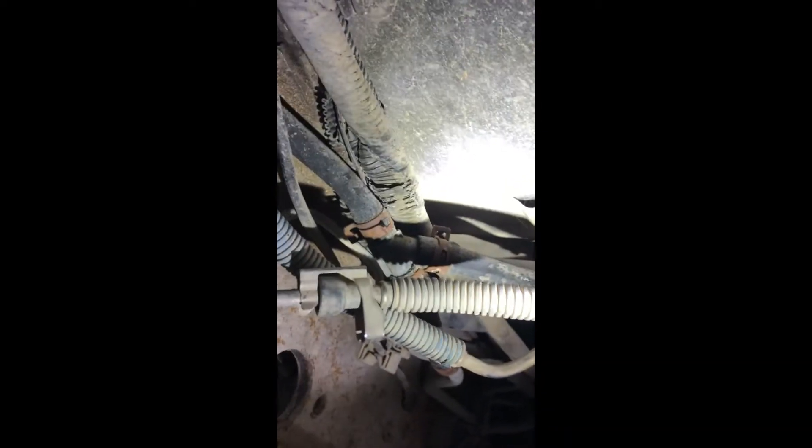I've been running this thing down for a while and got fed up with it, so I'm going to show you what I found and what I think has been the problem. That's the driver's front tire, and if you look underneath here, there's a fuel filter right there. Right there you'll see jumbled wires — I found these squished between the cab and the frame. Either at some point when Ford did some work on this and pulled the cab off, or at the factory when they built it, they squished these wires in between right here.